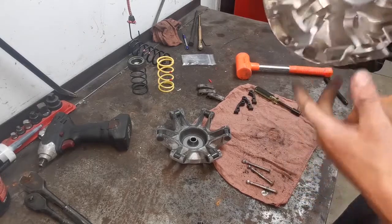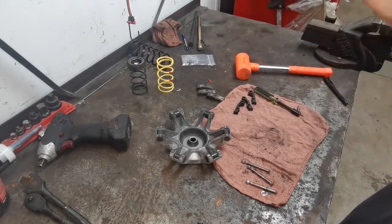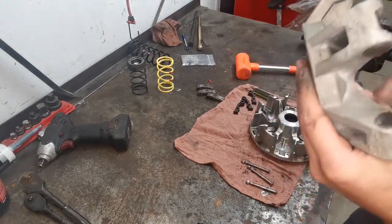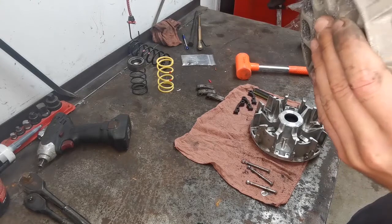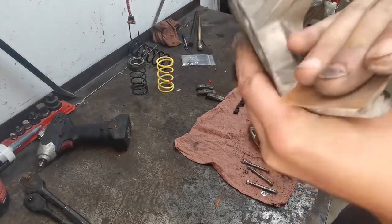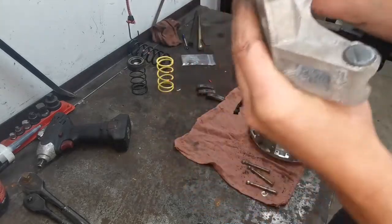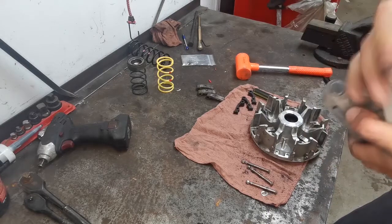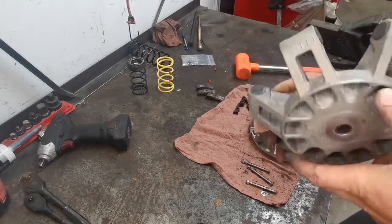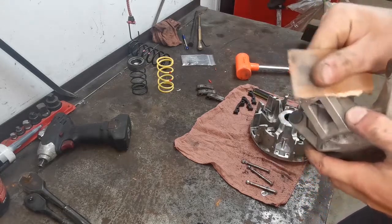Right, so once you clean the slides on that other sheave, it looks worse than it is, but there's no gouges. It's nice and smooth now, ready for a new home. Just a little service. You know, this is what you should be doing on a regular basis anyways. Clean up the buttons here equally as well. This is only a little plastic, so you don't want to go too hard. And when you reassemble everything, you reassemble dry. There's no lubrication here. It's simply just for them to glide nice again without having grooves and beginning to bind. So it's good to do this. We do this on the sleds as well, just to clean things up for the season.